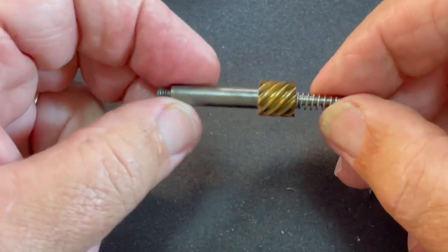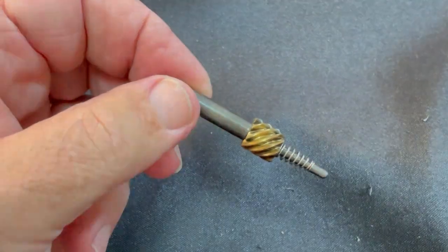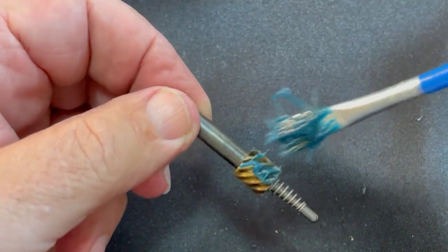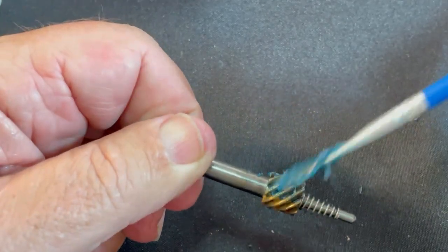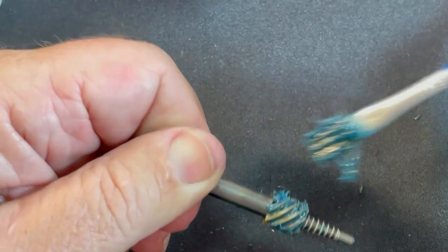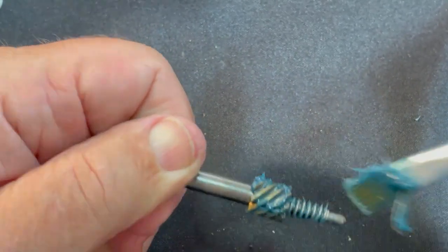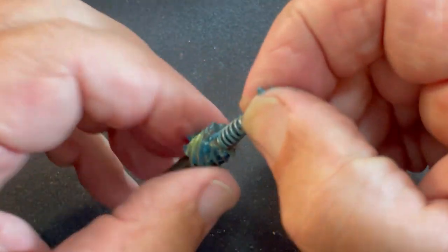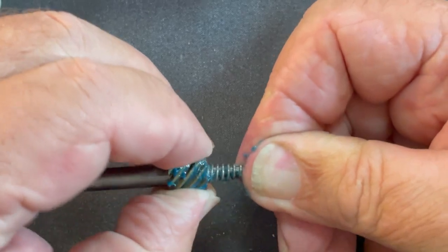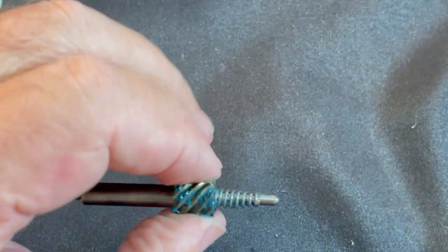We're back now with all the parts clean. We're going to start off with this pinion gear, and we're going to take and put a coating of grease on the gear portion itself. We're going to put some over here on the spring, because this is a slider. This is what operates your push button. When you push in your button, your pinion gear stays in place and the whole shaft moves forward. Okay, so you want to make sure to get grease on there.